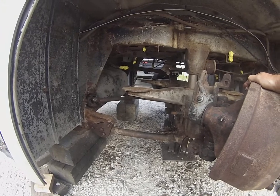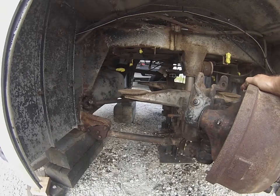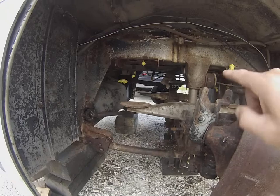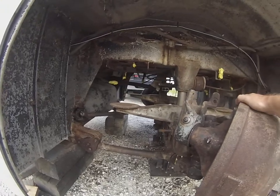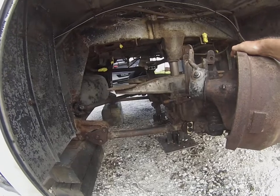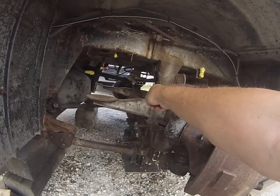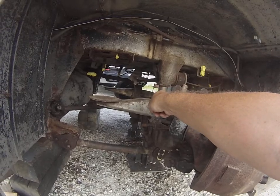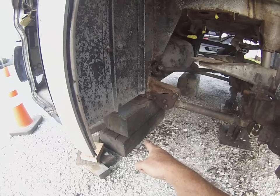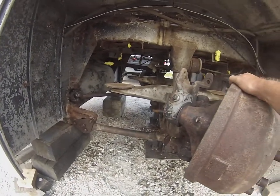Here, where the bolts weren't real bad, we could tell if a bolt seemed to be under tension, and if so, make sure you're using a long punch or something like that where you're not underneath the bus in case something bad happens. Obviously, we have the axle up, have the spacer in here where the bump stop goes, so that's where all the weight is, and then additionally have some safety blocks here in case something were to happen. The bus would rest on those.